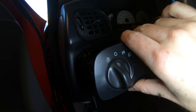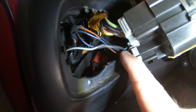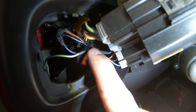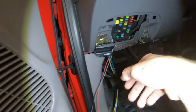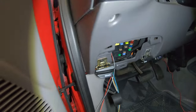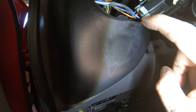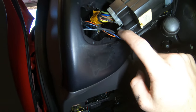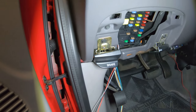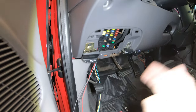The gray wire runs up and connects to a wire coming off the fog light harness. Pop that out and there is a bright blue wire with a red stripe coming out of the rightmost plug - that's where mine is spliced in. They soldered it and heat shrink wrapped it already, so I'm leaving that alone. I'm just gonna solder the gray wire to the existing wire that runs up to the fog light harness. It's the rightmost plug, top wire - baby blue with a red stripe. So: gray wire up to the fog light harness, red to your fusible power, black to a chassis ground - that'll power the gauge.